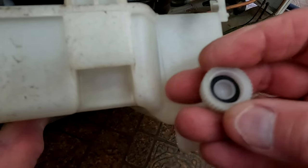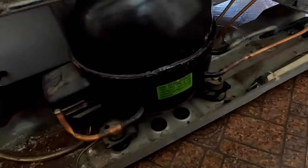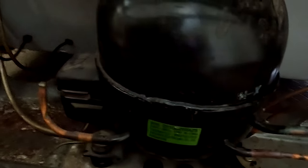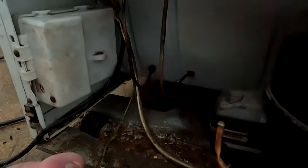Just in case, I'm also going to put another little o-ring in there because I have an o-ring kit. On many fridges you'll see on YouTube, they actually have a coil — like your room air conditioner has those aluminium fins. In this case, if they are exposed, very carefully give them a brush off or a blow with an air compressor, but don't be too close because you don't want to bend those fins. This Panasonic, which is 20 years old, doesn't have one. I also carefully vacuumed all the mouse droppings out of there, which were everywhere surprisingly.